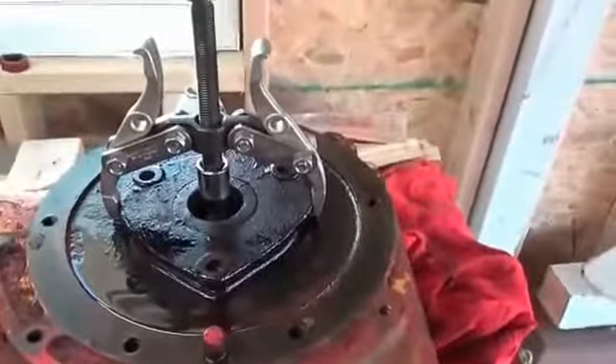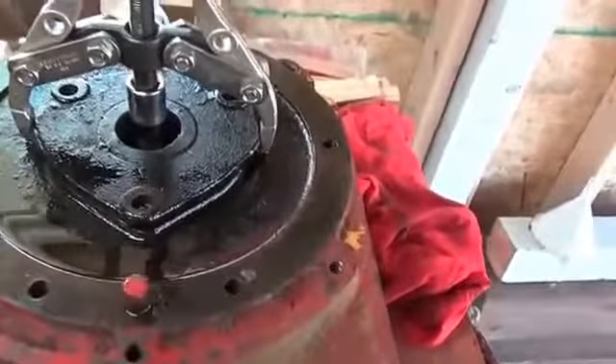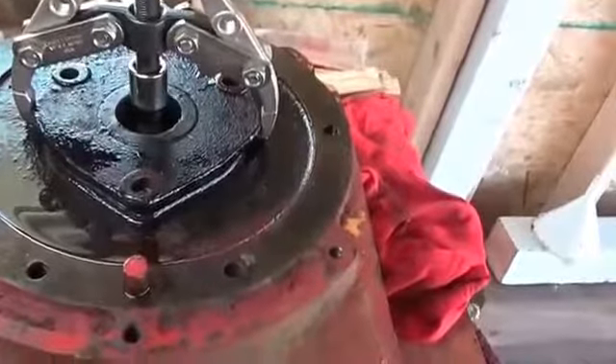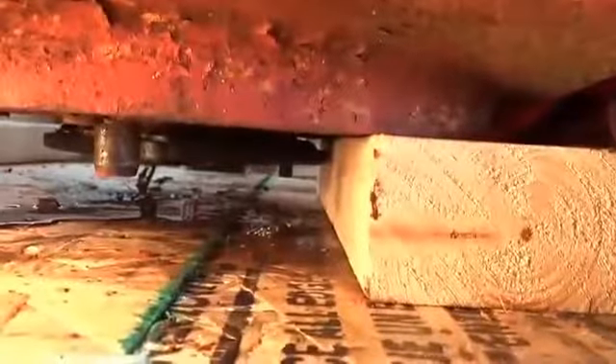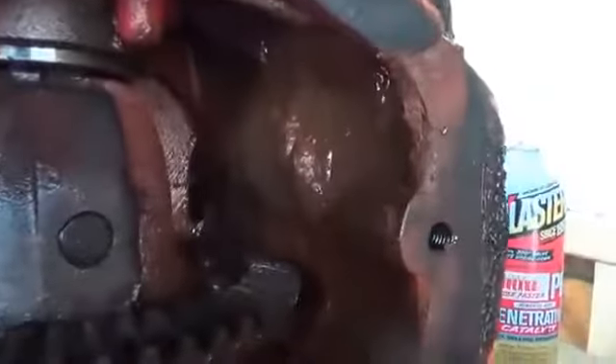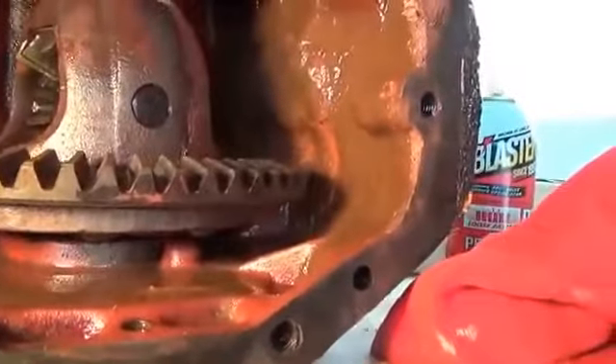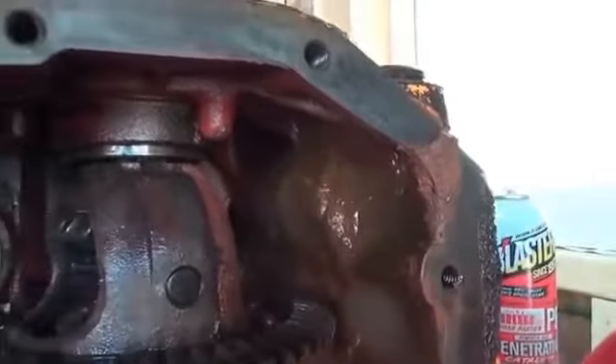Here's an update: the puller seems to be working just fine. I'm not having to put that much pressure on it. Obviously I'm worried about cracking the edge of these flanges — I'm not sure, it may look to be cast. One interesting thing that's happening: instead of this flange coming up, the flange below, as you can see, is being pushed down. I've got a good quarter of an inch, maybe three-eighths of an inch there. The puller appears to be pushing the differential down, and at some point I'm going to reach where I can't push any further, as the differential is going to be against the case. In that case, I'm going to flip this thing over and see if I can pull that side out, then come back and work on this top side. You can see I've got a good quarter of an inch off the bearing.